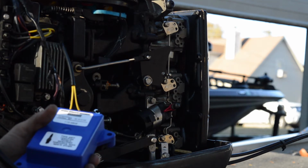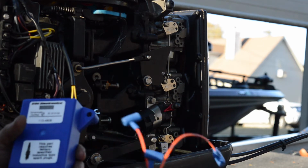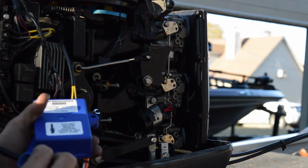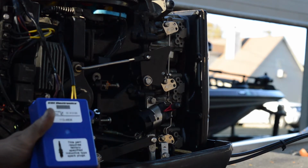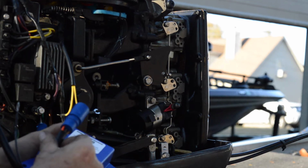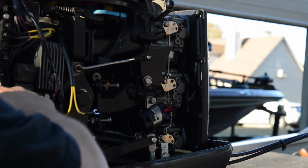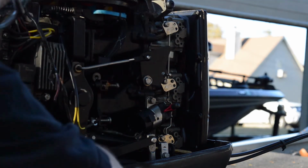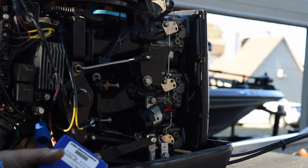And these are our 3 wires for our plugs, and this is our 2 connections that go to our stator and trigger. So this would be our timer base, and this is to our stator. The only thing on my end, I believe, on the harness, wherever that is, to find it, is plugging up our kill wire.